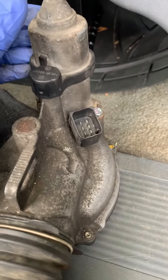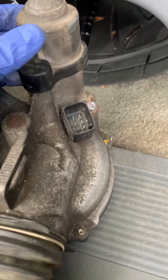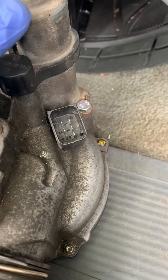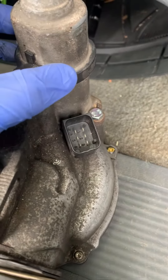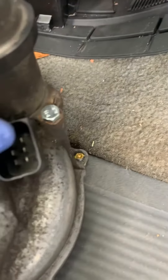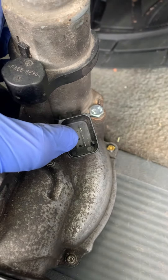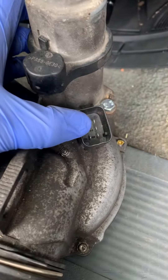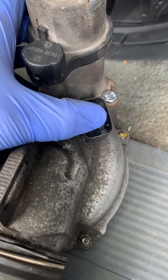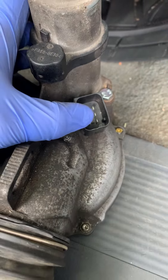This is how to retract a clutch actuator for a Smart ForTwo 2012. For me it worked with pins number eight and six — six is positive and eight is the negative — and that way you will retract it.